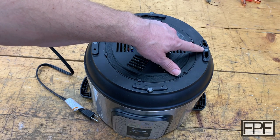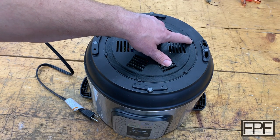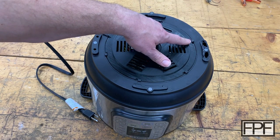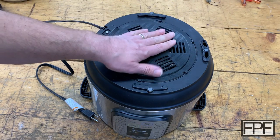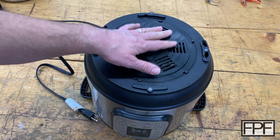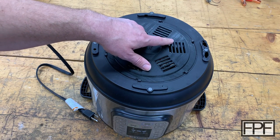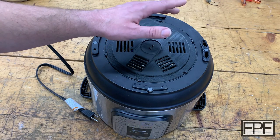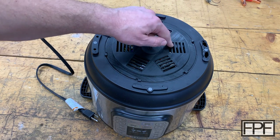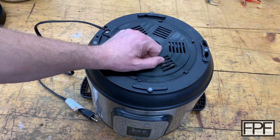Fortunately, the little rubber piece in the middle of the foot is still at the correct height so it doesn't wobble around at all. And while the retaining clip is a bit damaged, there are five in total that this guy rotates and locks on, and that one is still largely in place. So I wasn't too worried about those things. But this bottom cover absolutely needed to be replaced. I took some measurements from the original and designed this one basically to match it with one change. There was quite an angle on these louvers — I believe just from an aesthetics perspective to make it so you couldn't easily see into the bottom, but that it still flowed air. I made them just straight through to flow even more air and for ease of printing, and I don't think it's affected anything doing that.